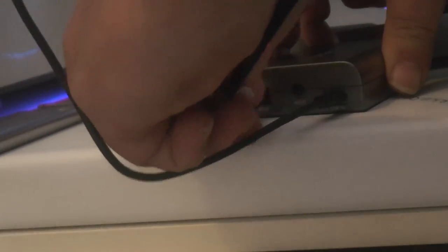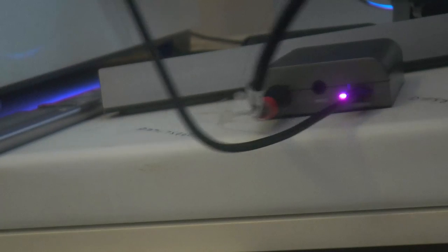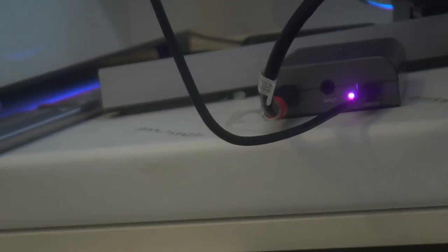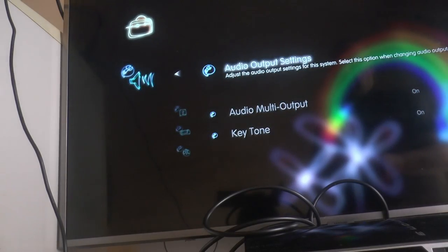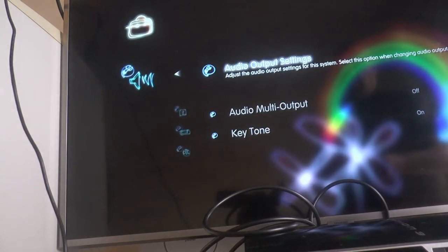There is also an optical audio cable in the kit that plugs into the wireless dongle, used to connect devices that have an optical output such as TVs and game consoles. Simply plug the wireless dongle into a USB source for power, connect the optical cable to the dongle and the other end into the device. In the device menu, select optical output and if able, turn the audio output settings to AAC. If the chair and the dongle are on the same channel, you should get audio from the chair speakers.